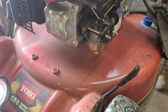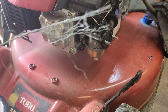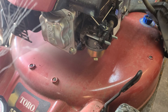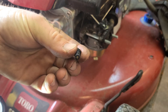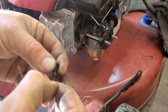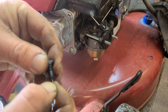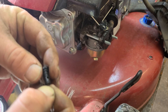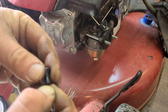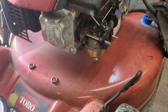So what you want to do is take one of these bicycle brake cables and unravel it so you've got all the little wires loose. Take one of them, take your little jet, and poke out that little hole. Work that wire in there and just kind of turn it, give it a little wire scrub inside of there — just clean that hole out. Usually this hole is plugged and that'll cause a surge on this one.